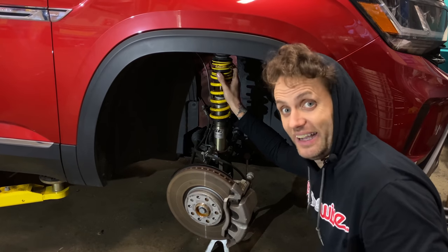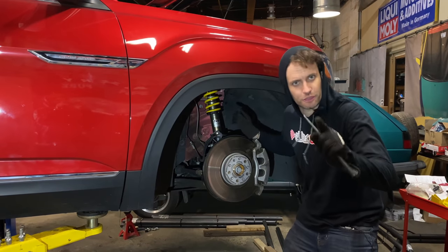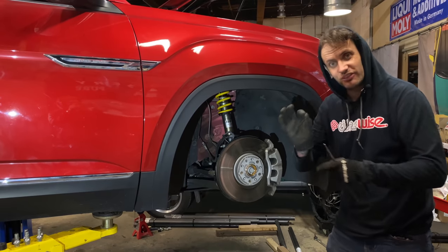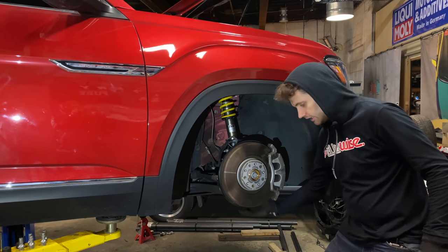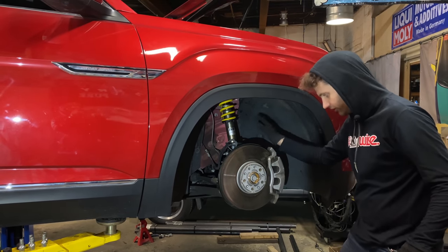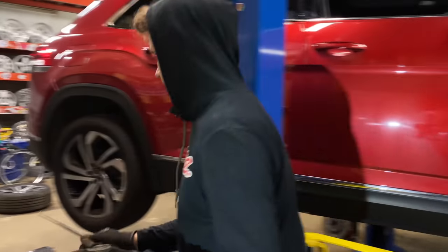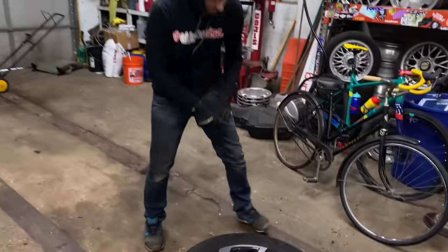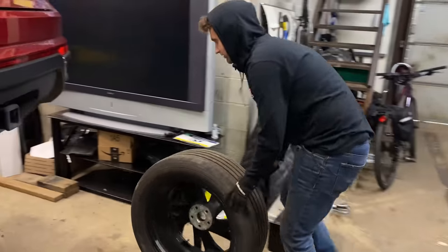I'm talking 22-by-10-inch ET20 wheels, by the way. Suspension is now in. We've set it eight threads from the bottom on both sides just to get us started. The camber adjustment is set to neutral right now, we've primed the suspension, and everything is torqued underneath. The ball joint is torqued, the one bolt on the suspension is torqued. The axle nut is tight but not fully torqued yet — we're going to push out the center cap on the wheel, lower it onto the wheel, then torque that center nut. That's an easy way to do it safely.